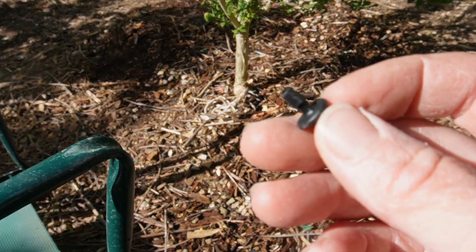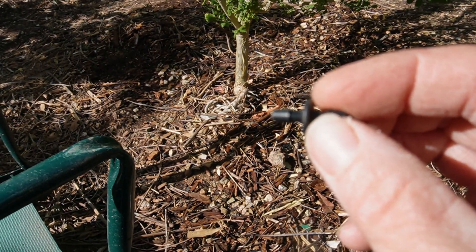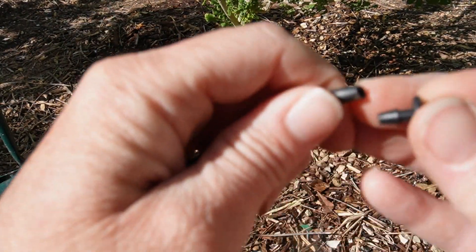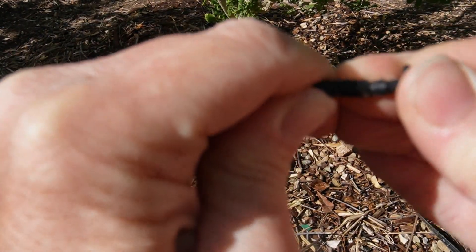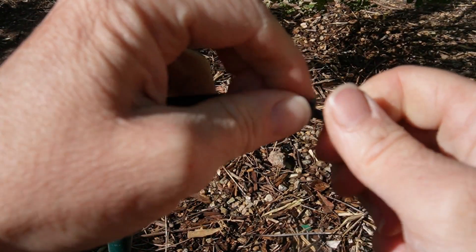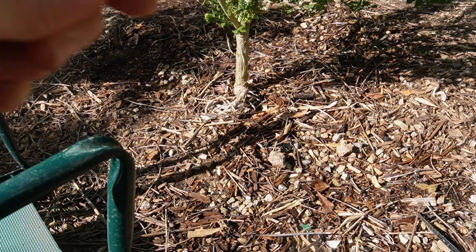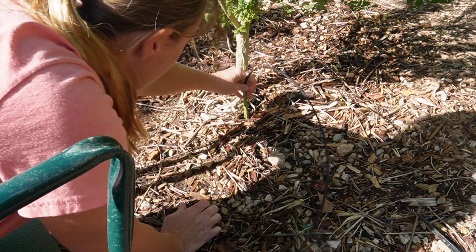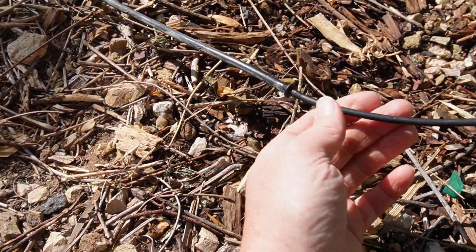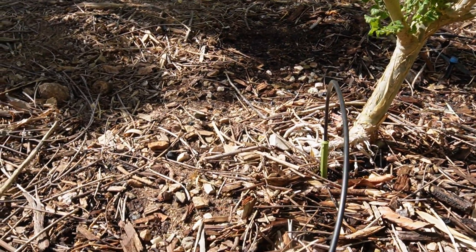To make this work, I'm going to use a special coupler where one end has a 1/4-inch barb and the other an 1/8-inch barb. For our spot spitter line that's 1/8-inch, we just plug that in, then make the connection to our existing 1/4-inch line. You can see that was our existing line, and now the coupler is extending 1/8-inch all the way to the trunk. Pretty easy to do that alteration.